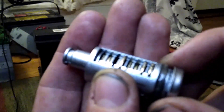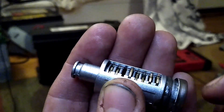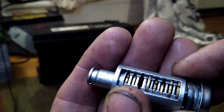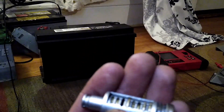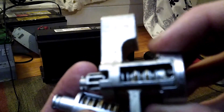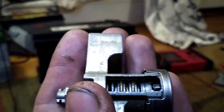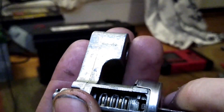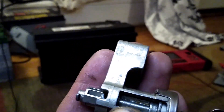If you're not experienced in taking these apart, doing this out in the field with somebody's actual lock might cause you problems until you figure out how all that works. But if you have a lock, like a lot of these Fords and a lot of other ones, where you can actually see the wafers without taking anything apart, then you can use this method to visually decode it if you are able to remove the lock.